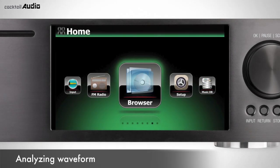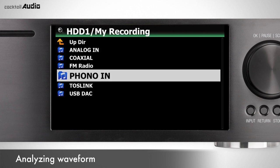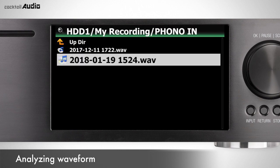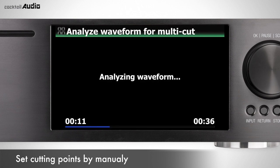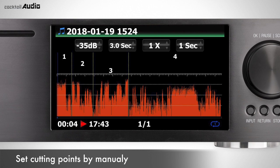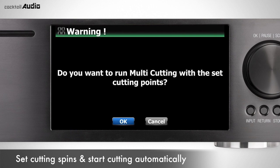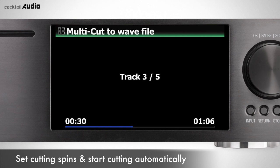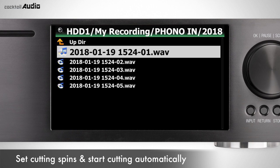Go to Browser Menu, select the recorded file, press Menu, and select Multi-Cut to Wave File to make a waveform file for cutting. There are four spin factors to set the cutting point: DB value, DB value duration time, waveform zooming, and seek time. Disable the four spins for manual setting; use left/right arrow keys to seek the cutting point, press the up arrow key to set it, and the down arrow key to remove it. Enable the four spins, press Menu, set the cutting point with DB value and duration time spins, press Return, and select OK to start cutting. Cut files are placed in a folder named after the original file.